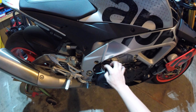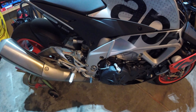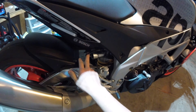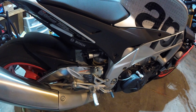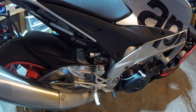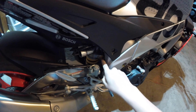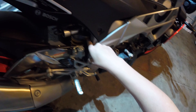Sticking with brakes - I did upgrade the fluid. Two weeks after I bought the motorcycle I did my first track weekend, and by the end of the second or third session I could pull the lever all the way back to the grip. The fluid was either boiling off or just inadequate for track abuse - though I was also probably too heavy on the brakes as a beginner. I went ahead and changed to Motul RBF 660 brake fluid and haven't had another issue since. I can ride it all day on the track with no brake fade whatsoever.